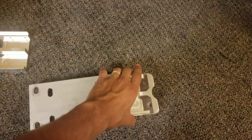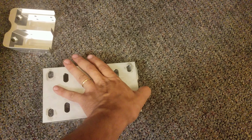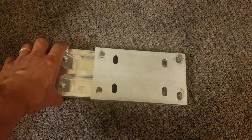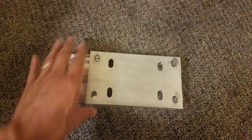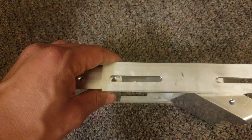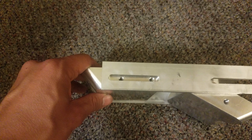so it's at an angle, and the other side is at a similar angle too, so it sits down there kind of wonky. And additionally, on the bike, the front would have to be all the way in and the back has to be all the way out, which makes it kind of flimsy. Only that little bit of material in there keeps it from torsional forces or any kind of up and down movement. And on the side you only have one spot to bolt it up, which isn't ideal. You ideally want both, not just the one. That's what I found out.